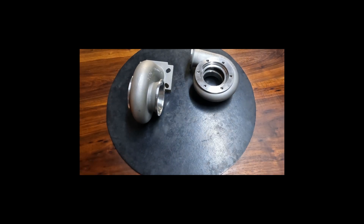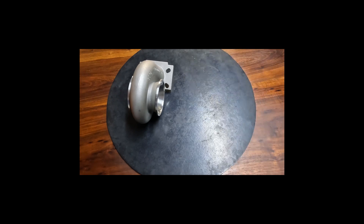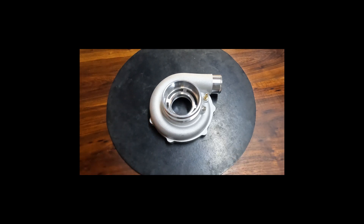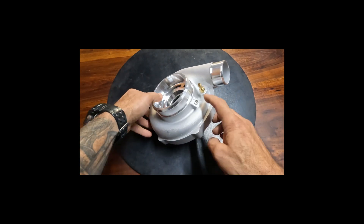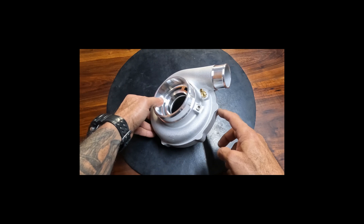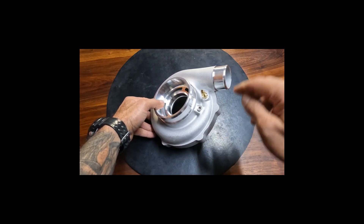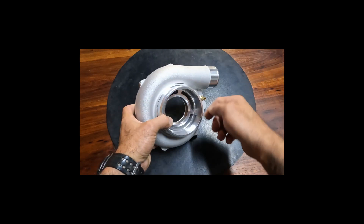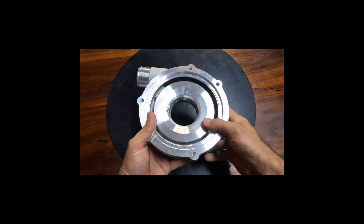Excuse the noise behind us — you can hear the guys balancing. We're actually at the manufacturing plant this morning, so you'll hear the balancing machines and stock being balanced and flow calibrated before packaging. Next we have our upgraded compressor housing. We've changed the AR of this housing to better suit the airflow characteristics of the modified compressor, and we've integrated a speed sensor port. It's not the traditional speed sensor supplied with Garrett and Borg turbochargers, but it is still able to pick up speed. We have a boost-only source, still a 102mm inlet and 50mm outlet, with the AR changed and the internal volute shape modified.